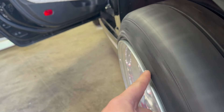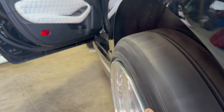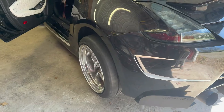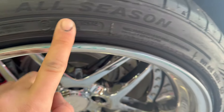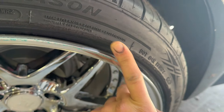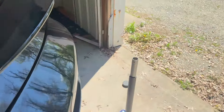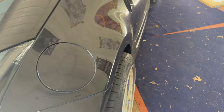I'm trimming this outer lip right here just so it doesn't catch as much. I just want to make it a little bit smoother — I don't want to crack my paint or mess up the quarter panels. I got the Z all trimmed up — you can see the little bit of tire beside it, but not as clean as I'd like. So I might have to figure out a way to make that look a little bit nicer, but I got the lip off of this one as well as this one.